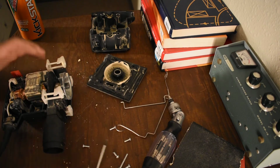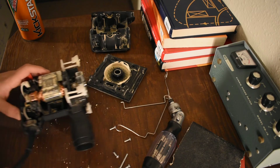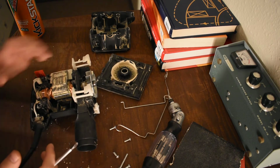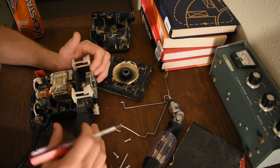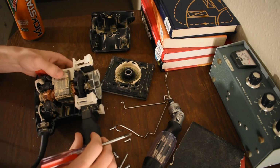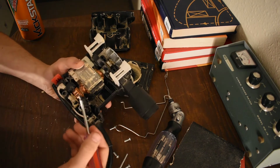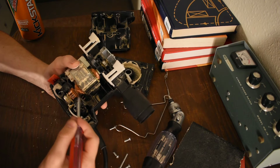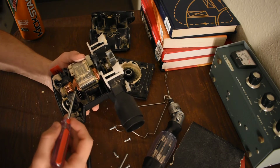Alright, so the first thing, I already can tell you how this thing's gonna break when it breaks. But it won't break. And the reason is you'll throw it out and you'll smash it to pieces before you ever work it to death. But let's pretend someone manages to use this thing without going insane, right? We can already see how it's going to break. There's no epoxy or anything on the rotor windings. Obviously they're enamel coated, but barely.